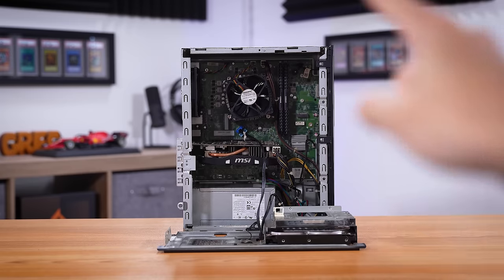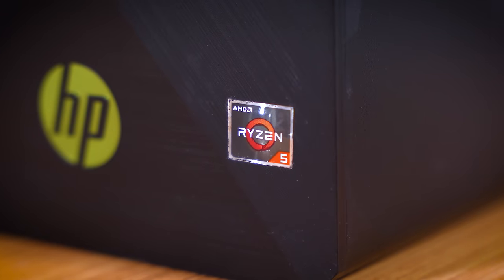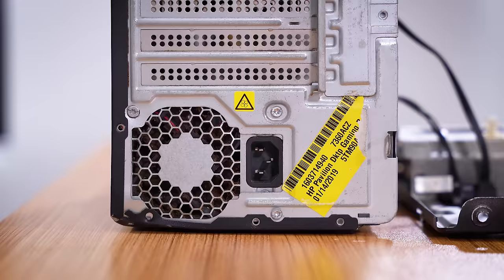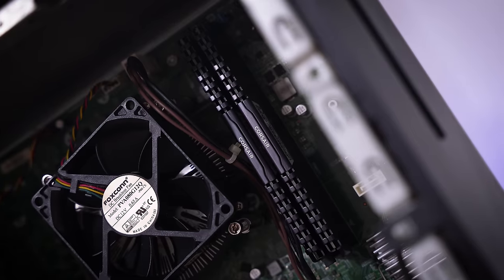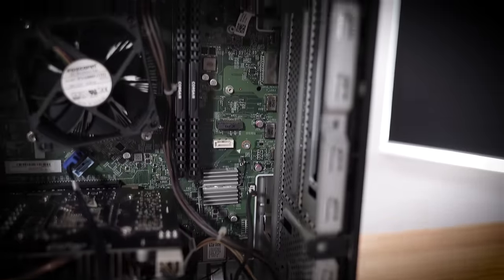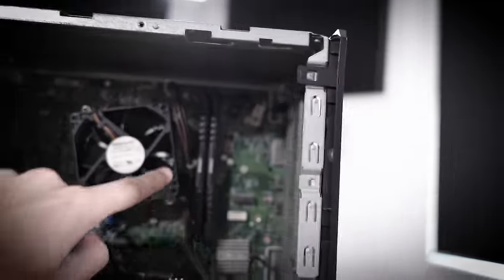This is that viewer's broken gaming PC and it sounds like we've got our work cut out for us this time. This is obviously an HP pre-built. I'm not sure if any parts have been swapped out since this viewer obtained it, but it is something that I'm a bit concerned about — not because it's an SI or something that was pre-assembled, but because there are some proprietary things in here that will be difficult to work around. I'm talking of course about the motherboard. HP couldn't help themselves — they have literally baked front IO into the right side of this motherboard, meaning this case and board are more or less symbiotic. You're not going to be able to replace one without the other because these ports line up directly with cutouts in the case.